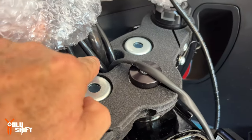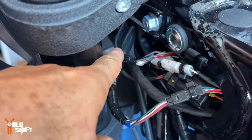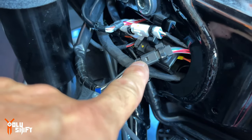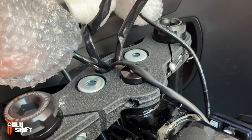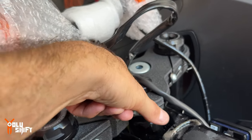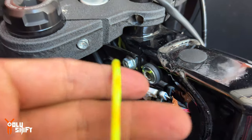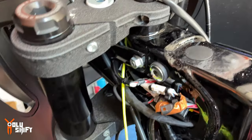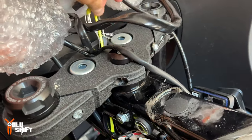What I'm doing now is literally pulling one wire at a time and seeing where it, you know, where it's pulling on the other side, exposing the connector and disconnecting it. I'm pulling these wires out one at a time, but what later on I'll need to run it through the hole, you know, it goes through here, then part of the frame and comes out over here. So I connected to one of the wires, the first wire, a little rope that it's gonna be my snake for later on to be able to get them all back in.